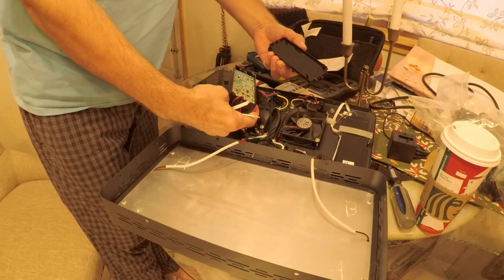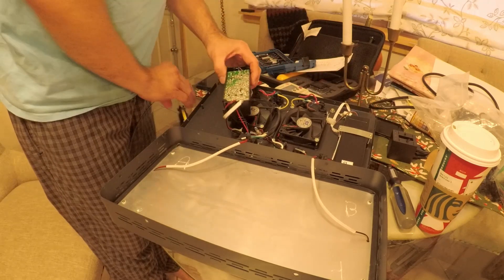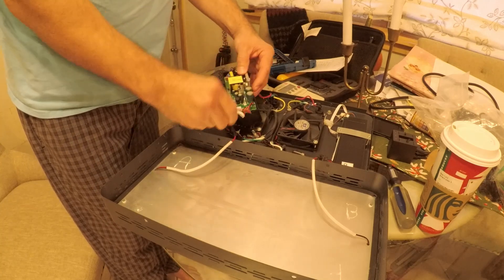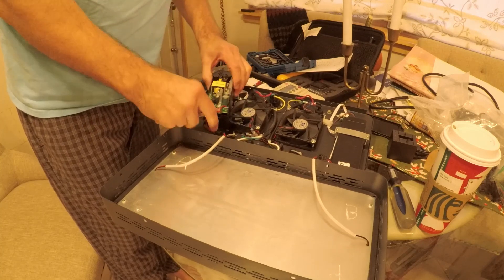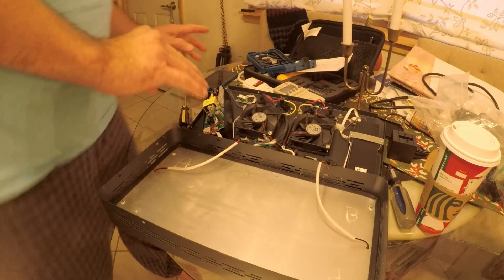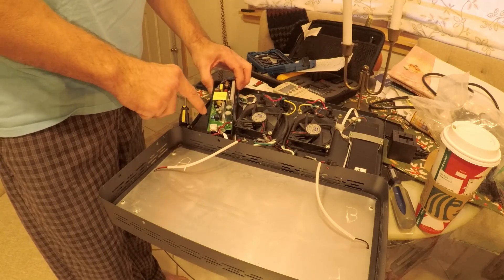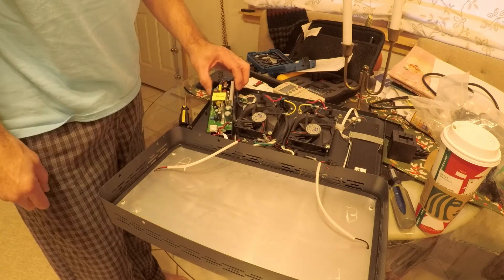To open the back of the driver box, all you have to do is take a small screwdriver and this back cover will pop off right like that. Basically you're just prying this back cover off — it's not glued down, it just snaps in place. What I like to do is take the driver and flip it upside down and kind of push it about halfway into the cover; it'll just help hold it there. You want to be careful here because you don't want to touch the main board with the screwdriver or anything like that, because if you short something out, you could ruin the driver.